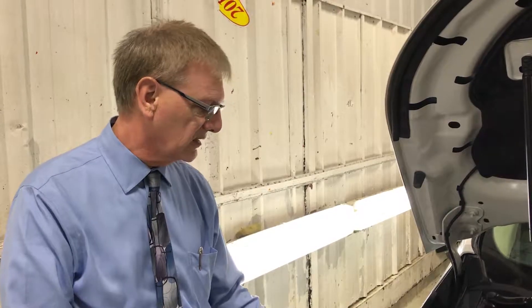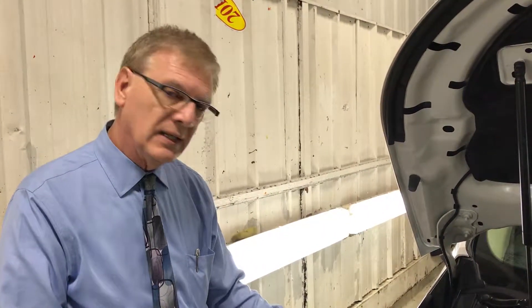Normally in a car like this with galvanized sheet metal, if you get a stone chip, you would get zinc oxide — white powder forming — which is the galvanized coating the factory puts on the metal to protect it. Once the air hits that, it wants to use itself up. Once the zinc is gone, then of course you have bare sheet metal and you'll get a brown spot, and eventually you could get a hole perforation through the panel.